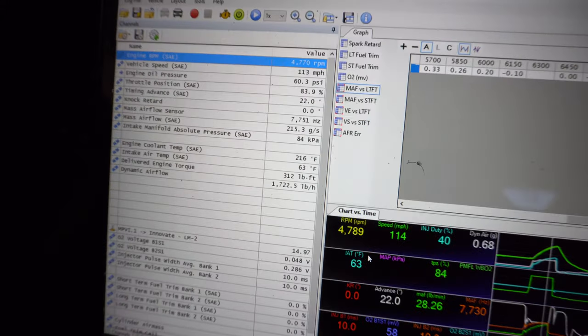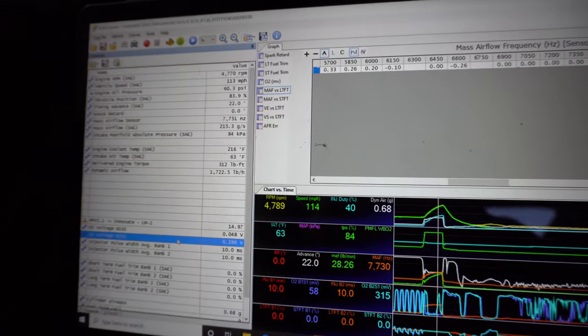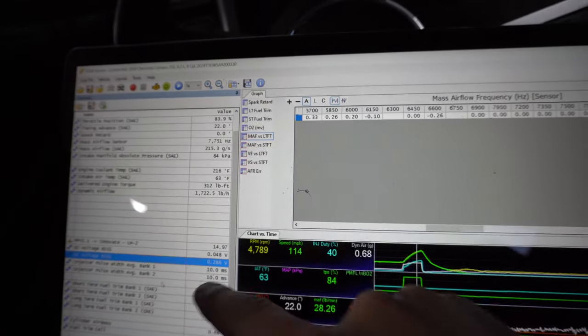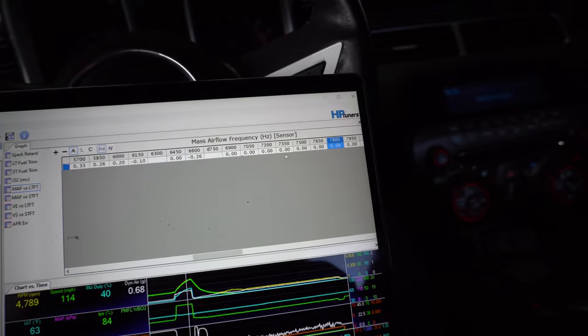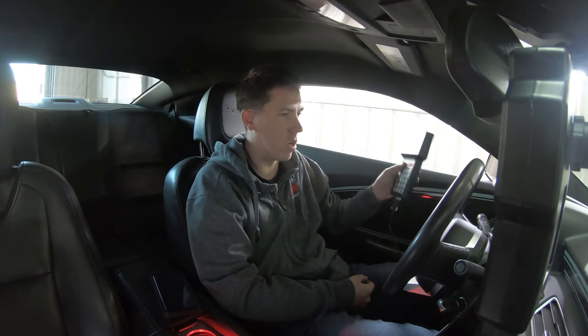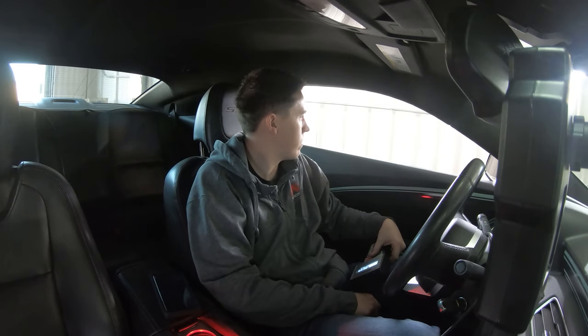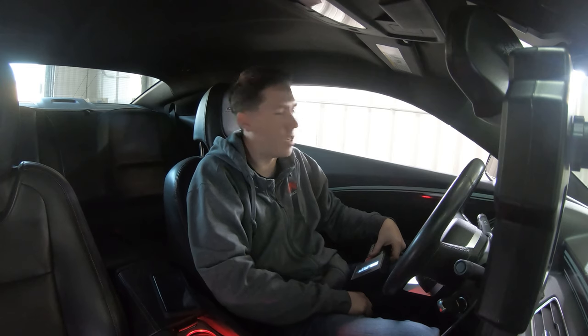It is definitely pretty lean just by rolling into it — it showed 14 on the wideband and the target is way off. I need to bring up the target air-fuel on the next one to get true numbers, but I can just calculate from what I want, which is about 13 air-fuel on this one because it's in the sniffer in the back of the pipe, which gives you about 12.5. You can already tell it's got a lot better fueling in it. That pass ended up making 364 horsepower and 472 torque.